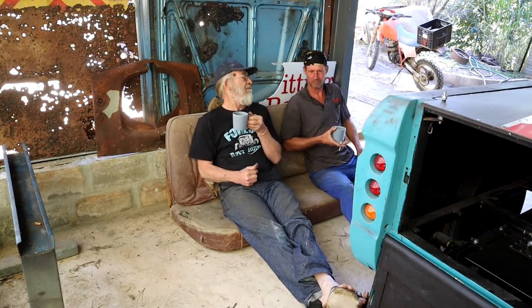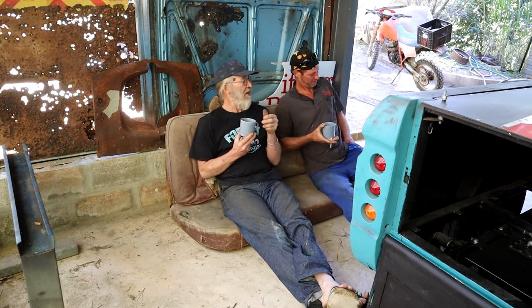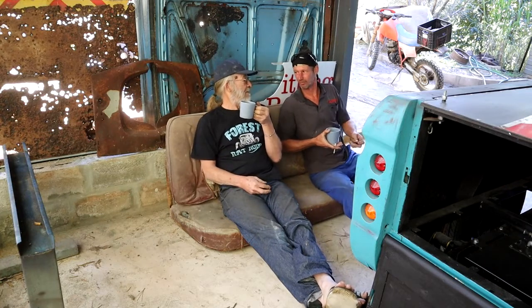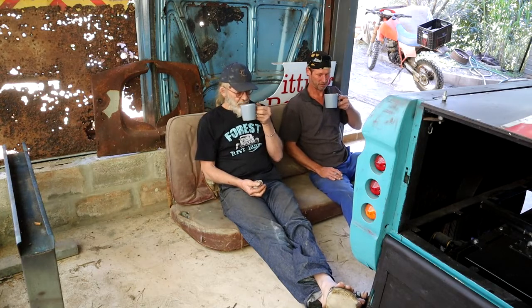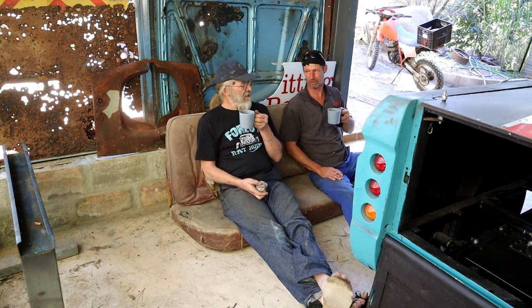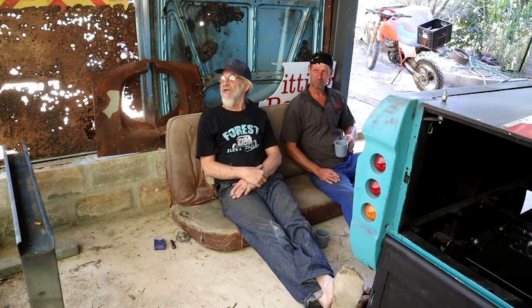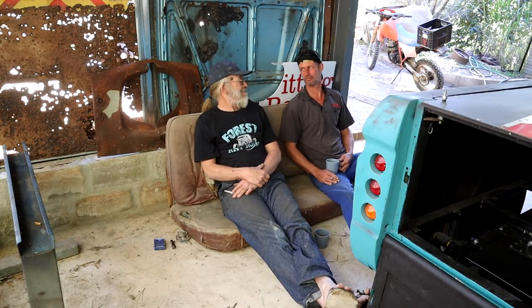So that sorts out the problem, and it's not my ignition module - it might also be messed up, I don't know. But I did try and do it - I'm pretty sure according to the diagram it's not complex, it's just four wires. Two go to the dizzy, one goes to negative on the coil, one goes to positive on the coil. So we're having a nice hot day again today - they say it's going to be 27, maybe 30?